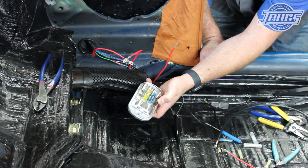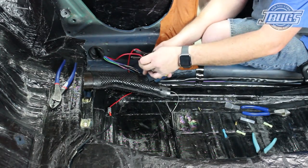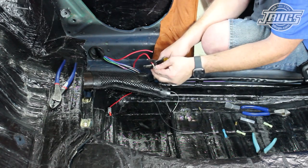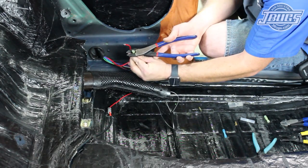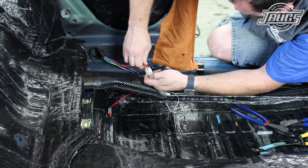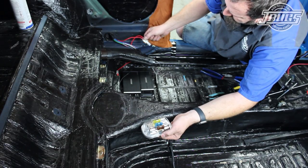Now, with a plan for hooking up all the main battery power, we'll connect the two wires in our main harness to a shrouded T connector. The connector has quarter inch terminals so we cut off the ring and the three-eighths terminal ends from our wires, strip the ends, crimp on some quarter inch shrink and glue connectors, and plug them into the T. Once we get the battery and our amplifiers installed, we'll mount the fuse box and wire up the main power connection.